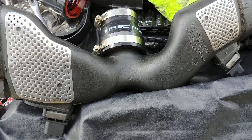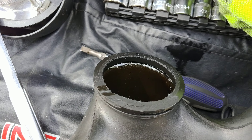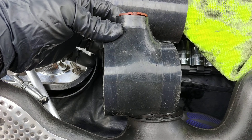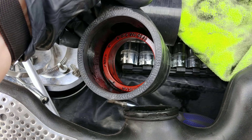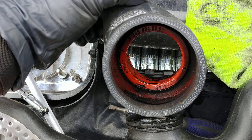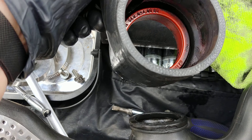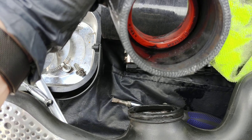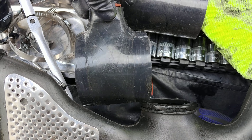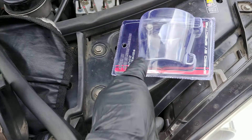The next problem I dealt with is the usual shattered flange on the mass airflow sensor Y-tube. I had to trim it and use a coupling. I experimented with a 70mm blow-off valve T from eBay for about $7, and it works great. But I was still plumbing the PCV valve into it there, which as I said I've since rerouted. The reroute has been done for at least two weeks now while I was cleaning everything and replacing the oil cooler gaskets, though it's still pulling oil accumulated in the intercooler. That 70mm eBay T worked well as a fix for a while, but it's not the real fix because you're still plumbing the PCV in there.